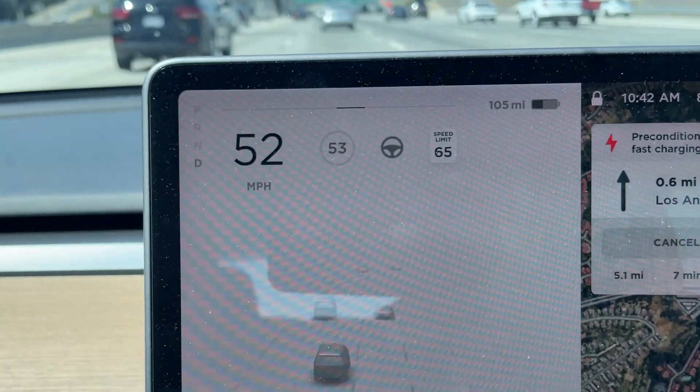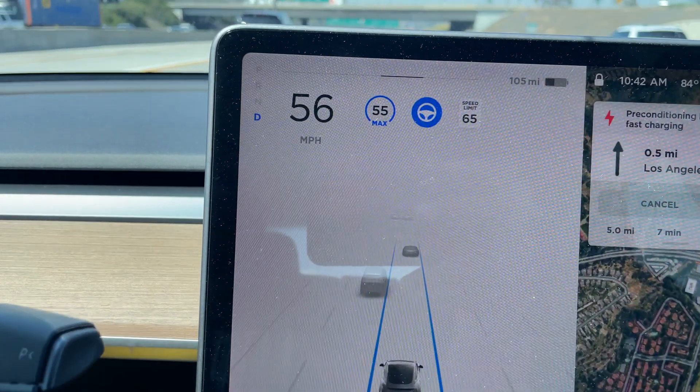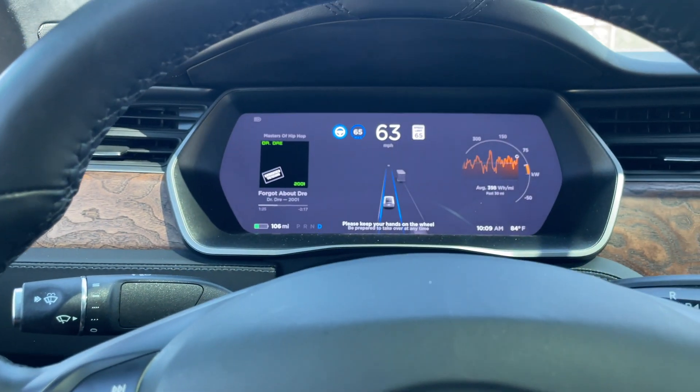So how do you initiate it? First, you need to locate the grayed-out steering wheel symbol on the screen — this lets you know right away that it's available. On the Model 3 and Y, you quickly double downward pull on the shifting stalk. On the Model X and S, you quickly double pull the cruise stalk towards you. You'll hear a chime that resembles a 'you're free to move around the cabin' chime on an airplane, and then the car will go into Autopilot. Be warned: if you are not close to the center of that lane, your car will shift you over to center, which can be jarring, so I try to make sure I'm closer to the center of the lane before I engage it.